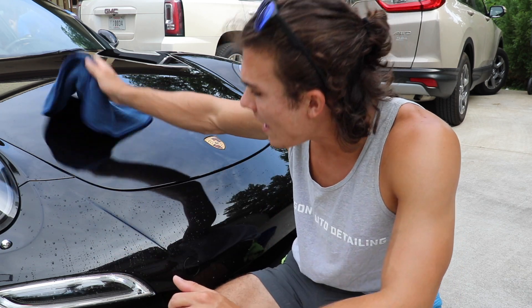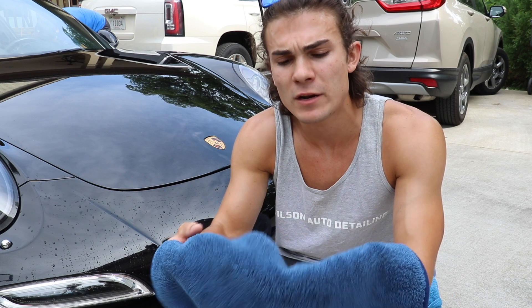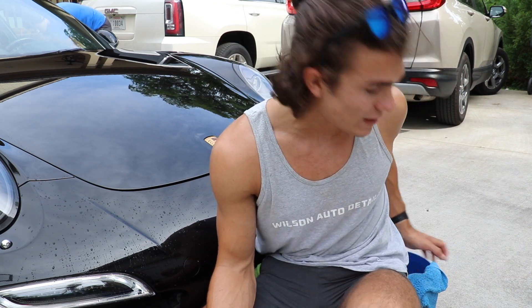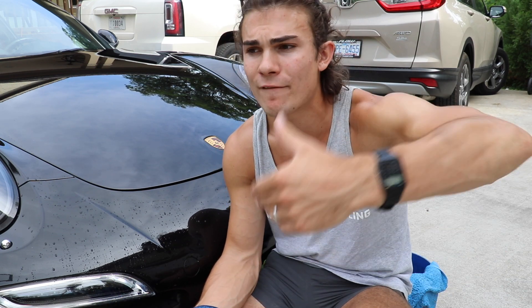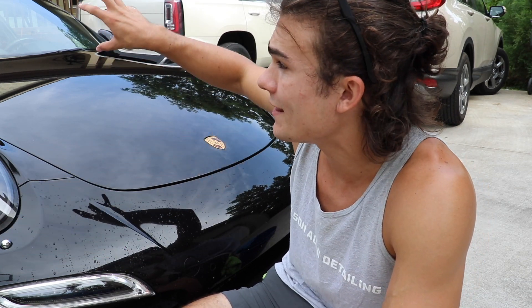For car paint like this, if I'm polishing I might pull out a totally new Kirkland microfiber towel to remove the polish — that way I know the towel's never been used. However, especially when dealing with higher-end vehicles, you're going to need high quality microfiber towels that aren't necessarily bought in bulk. These Max Shine towels have been washed three to four times and are still performing. Using them also avoids relying on a mitt, which gets used over and over and degrades. The one thing with the most potential to scratch your paint is the applicator — microfiber or mitt — so I rotate towels to avoid degrading them and scratching paint without realizing it.